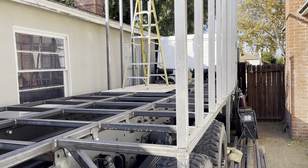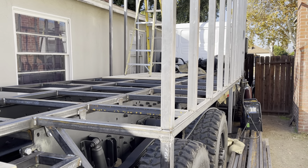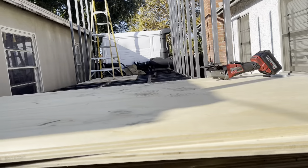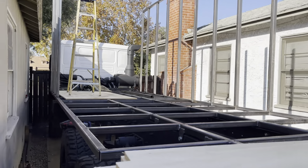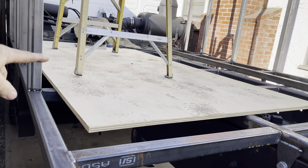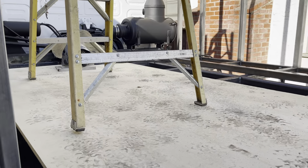The plywood is going to be Rhino-lined — Herculiner is actually the name of it, it's a roll-on bed liner. I've used it several times before on the adventure truck and it holds up super well. It basically encapsulates the plywood so it doesn't take on any moisture. It's a high-grade — possibly marine-grade — three-quarter inch thick, four-by-ten sheets. Up front I'm going to have to notch all of these in. Today is build day 24; I just concluded 23 yesterday.